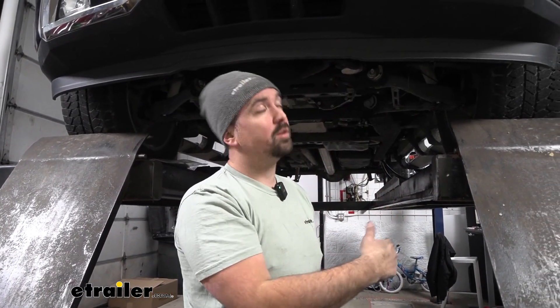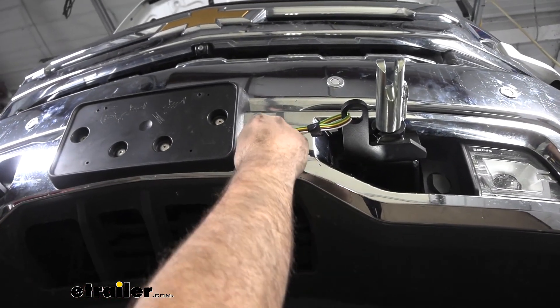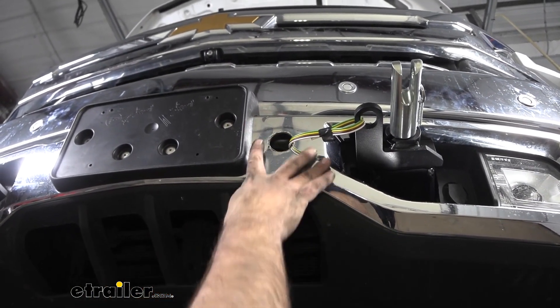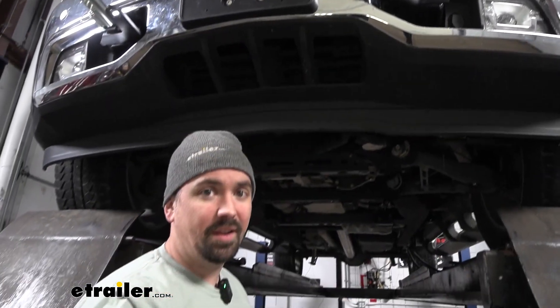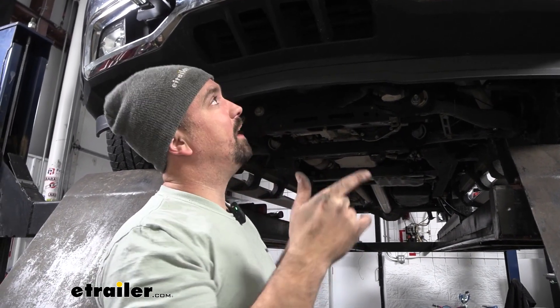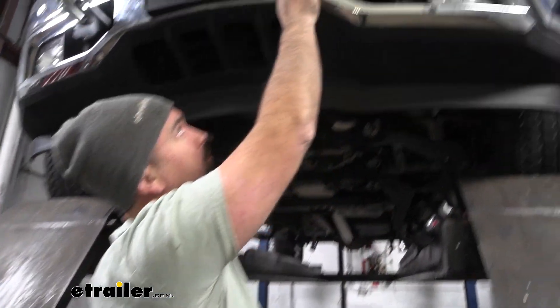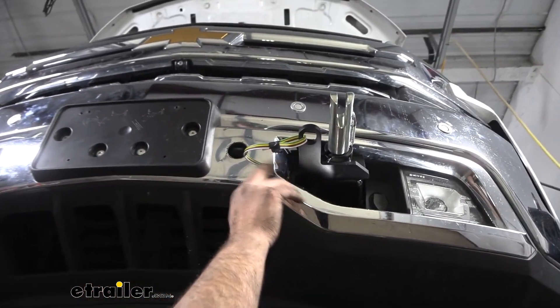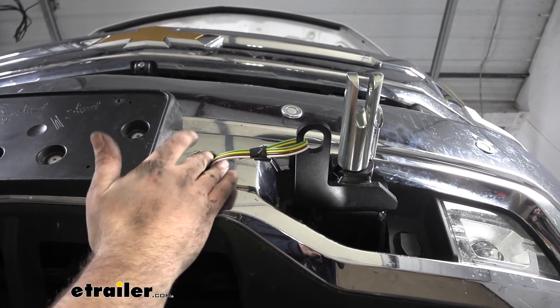Getting diode wiring installed is actually pretty easy — the hardest part is really just routing it from the front of the vehicle to the back. At the front we're going to be mounting up our six-pole, and I found a spot here on the bumper where I was able to use a step bit to drill this out and mount our plug. If you have a charge line you're going to be putting in, that's also going to tie in with the six-pole up front, so you might want to grab that red wire and run it up towards the battery. What I always do is give myself a little bit of extra wire — I've looped it around here and taped it so it's not going to pull as I go.